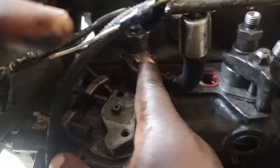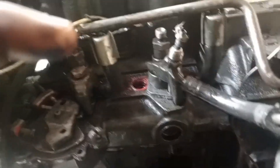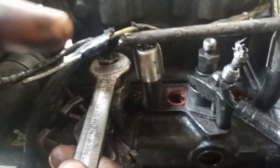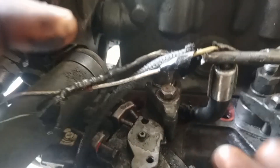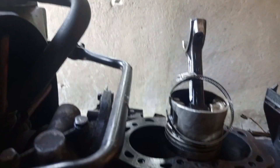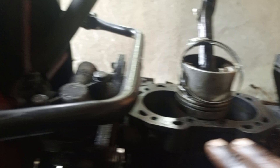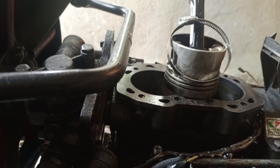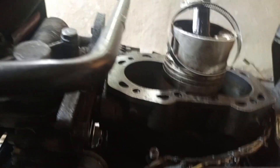For the adjustment, slack and loosen this bolt — don't lose this finger piece. Use a 19 spanner here, then turn it like this. As you are turning it, you'll see this part shifting. You can remove the exhaust pipe from the exhaust manifold like this, so you can monitor the smoke. Ensure all cylinders are working before you fix your exhaust manifold back to the cylinder head. Then you are sure that the engine is running better.